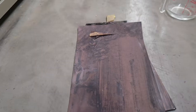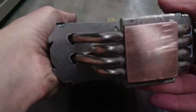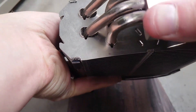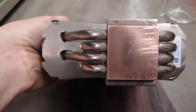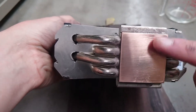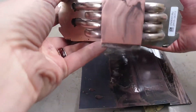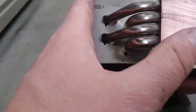After 40 minutes of lapping there's still a little bit of nickel plate remaining, which shows how uneven it was. I'm going to move up to a higher grit to smooth it out. After an hour of lapping we're finally seeing all copper, so it should all be level now.